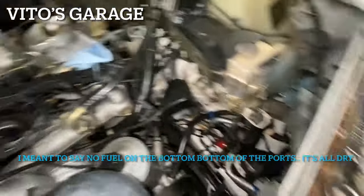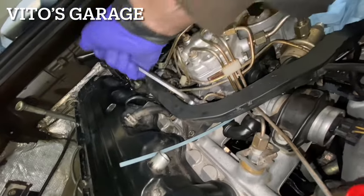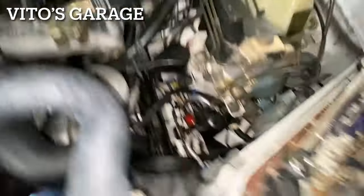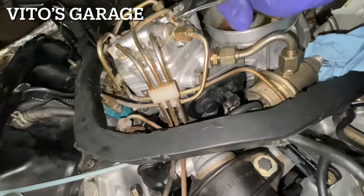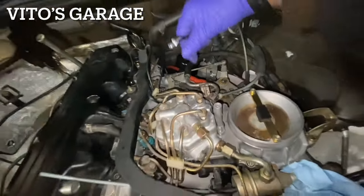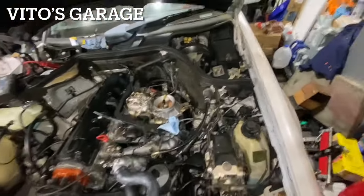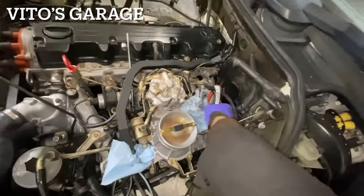I may need to loosen these other lines to the injectors — I might just swap the distributor. The car was cranking well this time and we have spark — I checked with the spark tester. I can see there's no fuel in there either. It's probably just clogged, because when I took out the EHA valve it was squirting fuel like crazy. I'm going to pour a little bit of fuel in there and see if it starts.